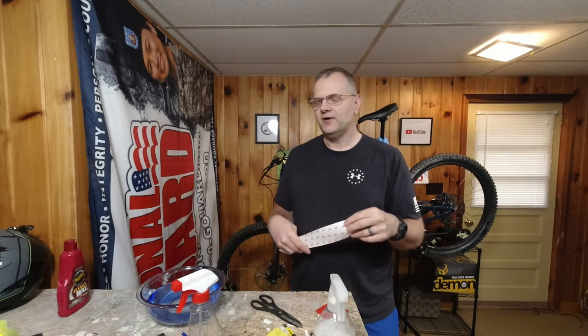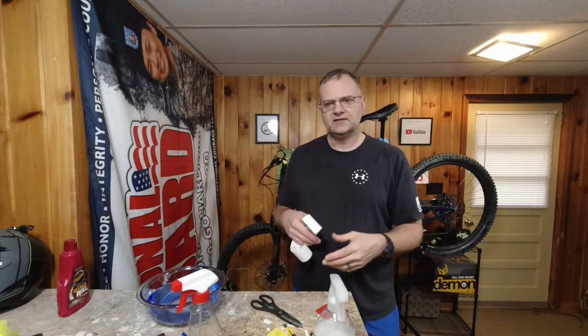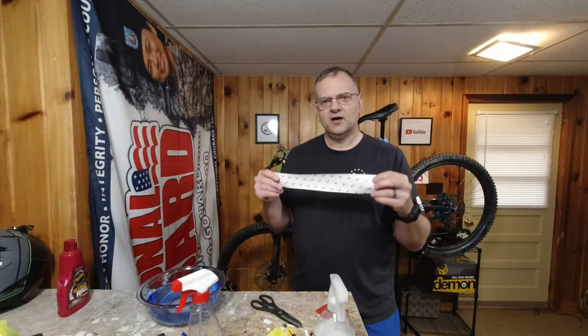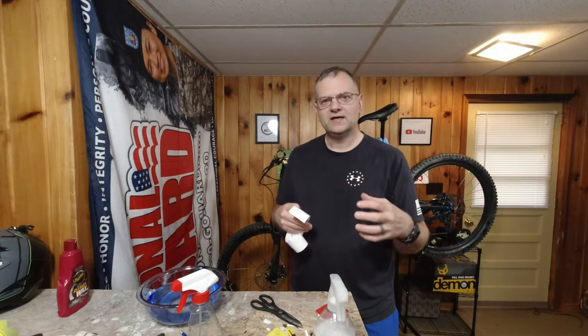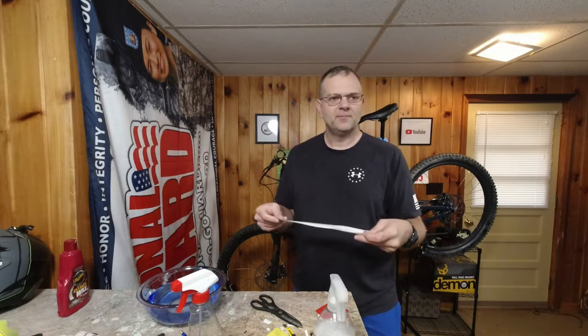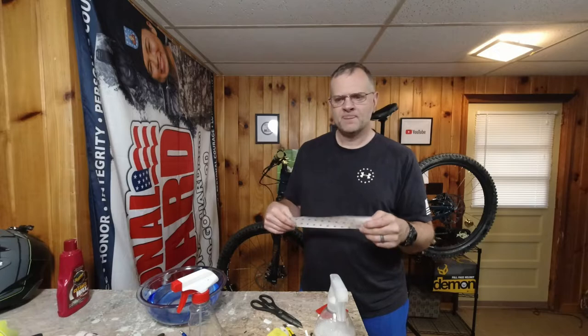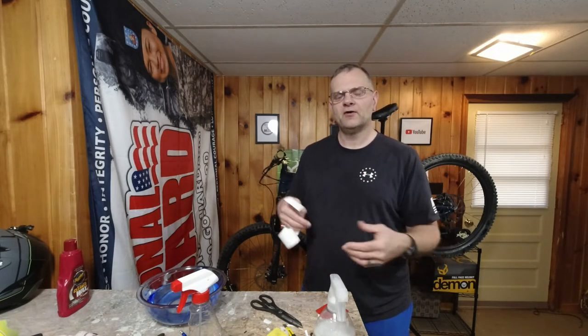What would also help, I know because I've done this before with stickers, decals, and some other things, is a heat gun. A heat gun's going to help, even a hair dryer. A hair dryer moves a lot of wind though, so you want to be careful with it. You don't want to blow things into your frame protection, like dust and whatnot. So the heat gun moves more heat than it does air, so that might be a little more advantageous to you. Just don't get carried away with the heat and burn it. I didn't need to on this. I didn't use it on a lot of contoured areas. If you have a lot of contoured areas, you might need to do that.